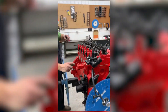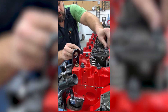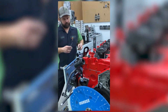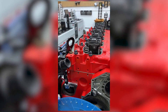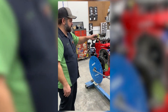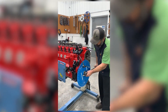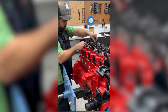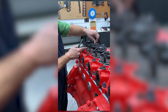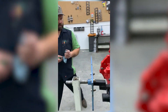We're on number one, all set up. We check the intake — we've already adjusted these so we're just verifying — and we cannot get the 16 in there. Then over to the exhaust: the 22 fits, the 24 won't go. I typically like to hear a little snap when I pull it out — just a little snap — so I know there's no lash and it's accurate. With the degree wheel on number one, number five is next, so you go 120 degrees and that puts you on TDC on cylinder five, then go on down the line.